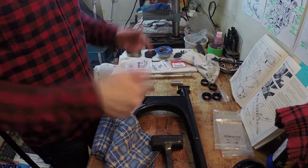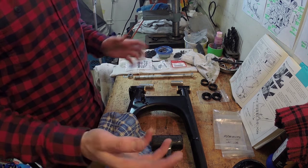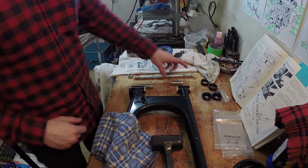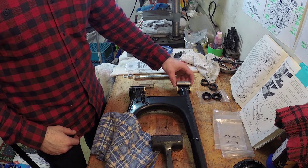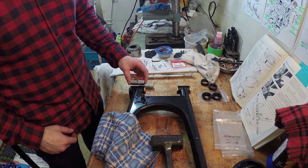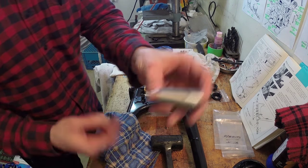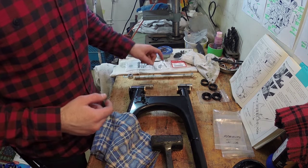We're going to start with the swing arm here. You want the swing arm facing up like you'd install it on the bike, so when you're driving there's a left and a right — because there is a right and left bushing. This one will fit here, and it won't fit here — you can see it's just too small. So there's a left and a right bushing. These are brand new nice bushings; I smashed the crap out of the other ones getting them off.